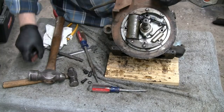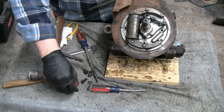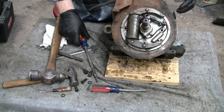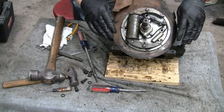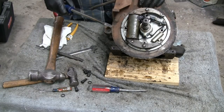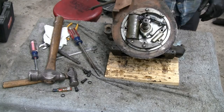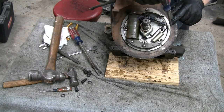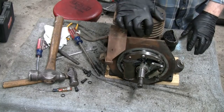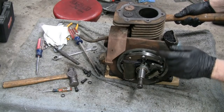These backing plates are a tight fit — they're so tight they feel like they're stuck and jammed, even if there's just a little bit of angle to them. On the Fs and FHs and probably the Ys, everybody tries to stick a screwdriver on there and pry them out, and that's the wrong thing to do — that's a sure way to bust them. The way I've found that they break loose the best is to hit the crankshaft with a hammer from the back, and the crankshaft actually pushes it out evenly.